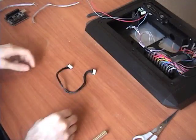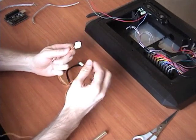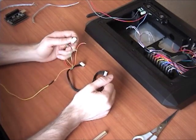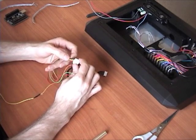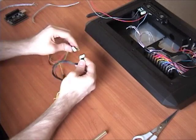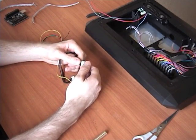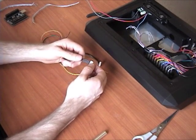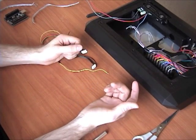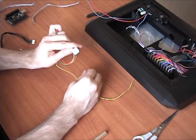You can keep using the existing joystick connector or buy an actual JLF harness - they're about five bucks or less. What you get with the JLF harness is a clip that locks it in place and helps you align which side is top. The generic connectors happen to be the right spacing that Mad Catz used but have no clip to hold in place, and once you remove the glue they're prone to falling off. You also can't tell from wire colors which side goes up or down, so you might put it on wrong and the joystick won't work or only a couple directions register.